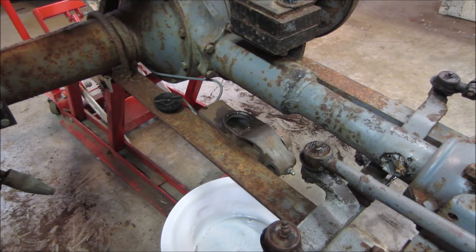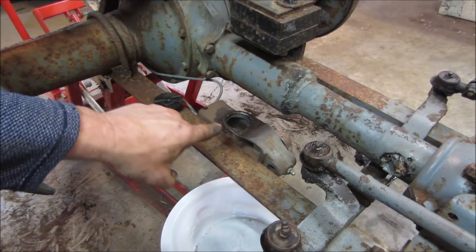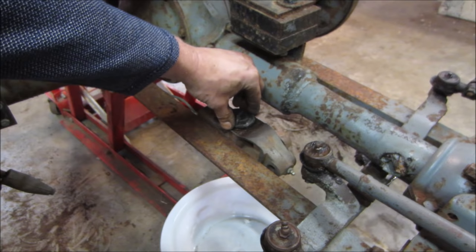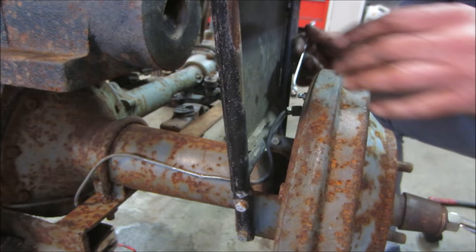It's starting to build up pressure now. So what it's doing, it's filling up the line, but there's air in the wheel cylinders. So as soon as you let off, the wheel cylinder air wants to push back, and it pushes all the fluid back out of the line. So let's go cap that off, go get ourselves a bleeder wrench. Get some brake pedal. Is it the right size? I have a feeling it's not. Nope. Good.